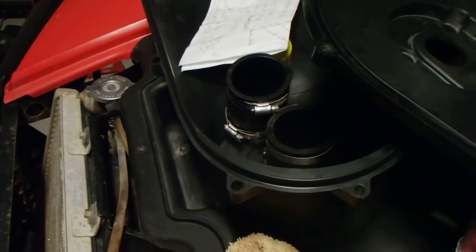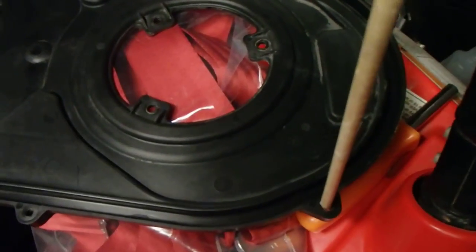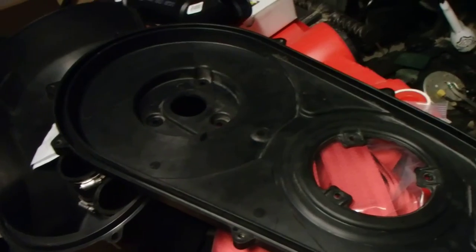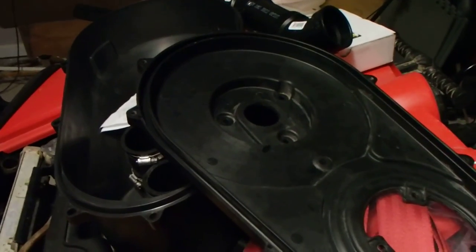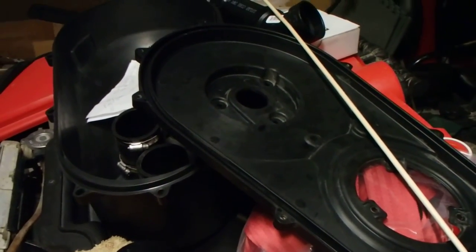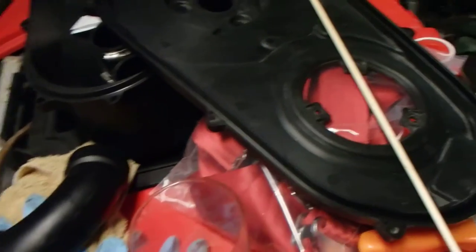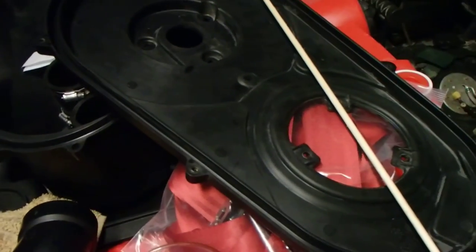How do you get this belt box to go on nice and smooth? Same thing — take that dowel rod and insert a few pieces onto the back plate in a few different spots. That gives the front cover a smooth ride on. When you've got it nicely greased and you start juggling that thing trying to put it on, you're going to squish grease out in the wrong places. Like a million other people online, you'll have a leaky box. You don't want to seal this with crazy sealant because you're never going to get it off without having to buy a new belt box cover back plate or other parts.